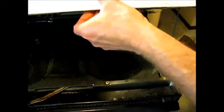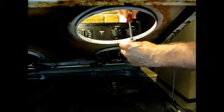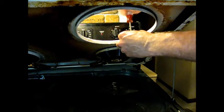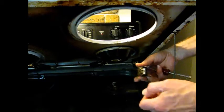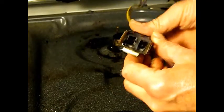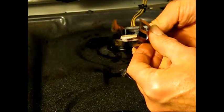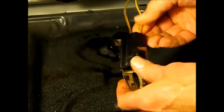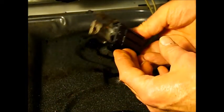I'm just lifting it up. You can see the element under there — it's held on by a quarter-inch nut driver. Taking a closer look inside here, we can see that the contacts in there are pretty beat up. It's pretty burned. So I'm going to pull it out and replace it.